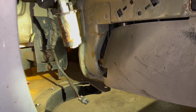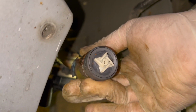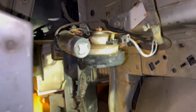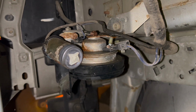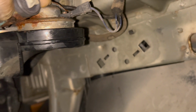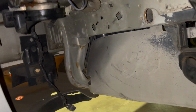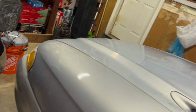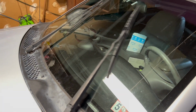And the wipers are going. I don't hear anything coming out of that motor. It should still be spraying, but it ain't. So just to make sure, one final check. I don't think it's even going to rotate at all, so I just want to see that on camera. Okay, here we go. Yeah, see, it ain't even spinning. Sometimes you give it a little knock, but I suspect water got through the seal. Seal went bad, motor shot. Yep, all right, so we confirmed it. Motor shot, so order a new one, and we'll be back in business.